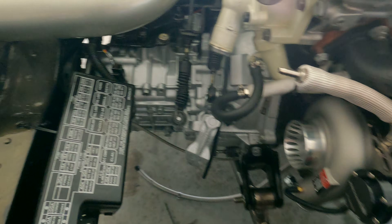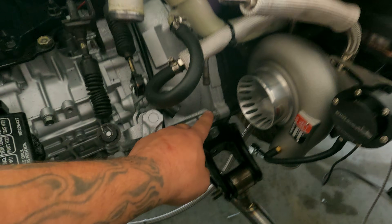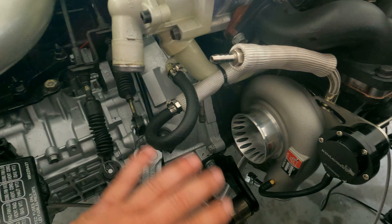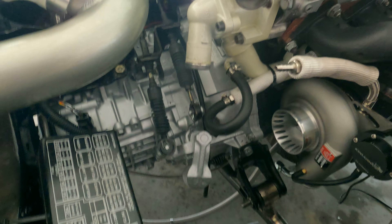I painted everything with ceramic spray paint, which is good. I replaced all the bell housing mounting bolts with brand new ones and labeled them because some are different sizes and lengths — I marked them one through five so I know where each bolt goes. There is a difference with the speed sensor: the GST and GSX speed sensors look identical and bolt right up, but they don't function the same. My speedometer is not working — I contacted Extreme PSI about it.